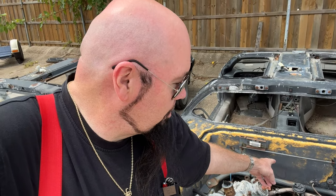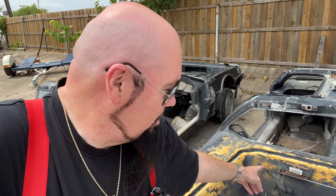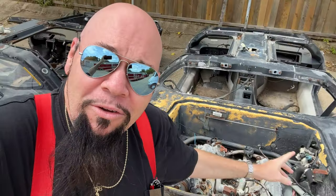Follow me over here — we work on DeLoreans and other cars like that here in my shop, so Ferraris, Lamborghinis, DeLoreans — a lot of rear engine cars that use mechanical fuel injection systems like the Bosch CIS system that have those plastic fuel lines. What'll happen is, like what happened to this DeLorean here — it caught on fire because one of the fuel lines ruptured and started spraying. It probably hit the resistor, caught on fire, and burned the car to the ground. If one of those balls had been mounted back there, it would have put it out.